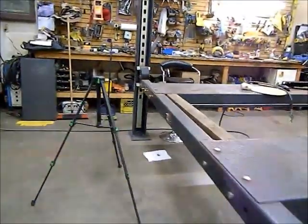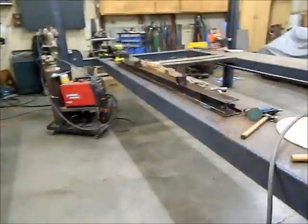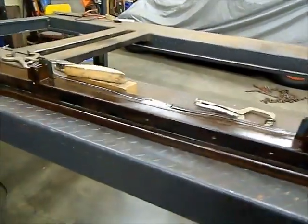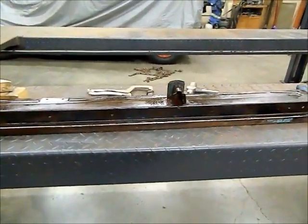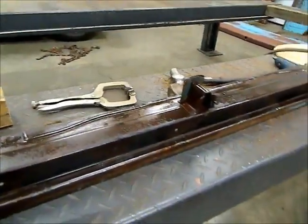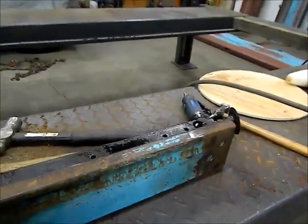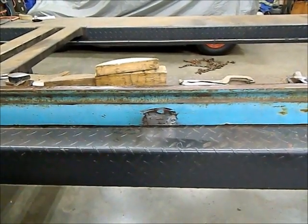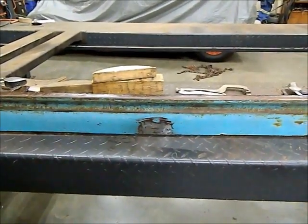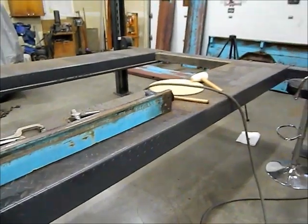Right now what I've been working on is the rear lower part of the box below the tailgate. I got everything cleaned up, wire brushed off the loose rust, and I just finished spraying it with rust converter so it's ready to go. A little rust converter on the fingers never hurt anything. On the back of this, for some reason they cut a notch and bent it out and put a license plate light in it, but I got that bent back in place, patched up, and welded. This piece is ready to go back together.